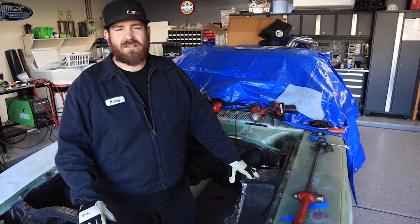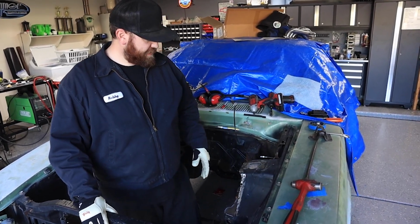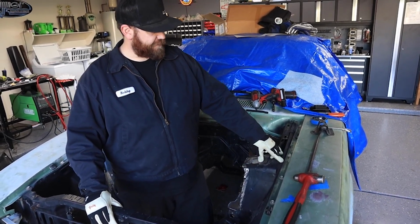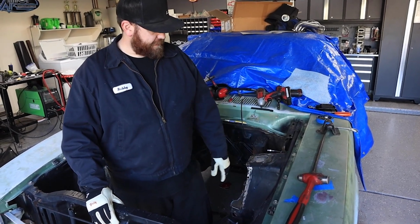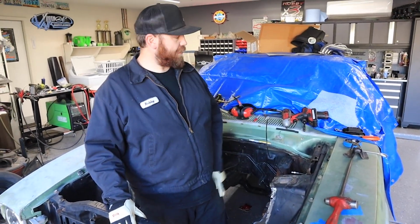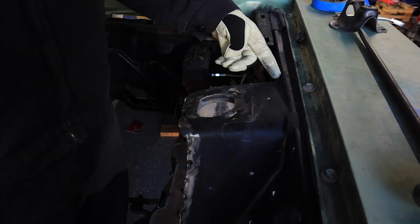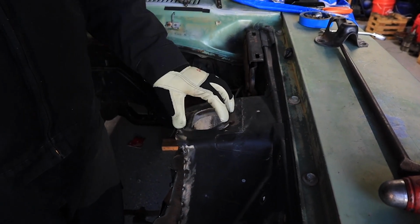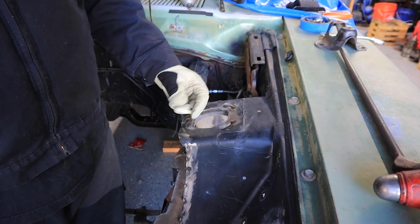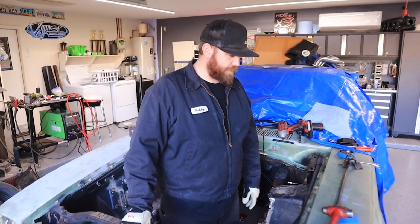And there's another plane flying over. But, so that's the plan now, is to take this shock and spring mount and move it further forward out, and then replate it, retest fit the engine, and see if we can get those turbo headers to fit. So I'm gonna just cut this out, move this way. So basically we'll be gaining that much room on this side. And hopefully it works. We'll make it work.